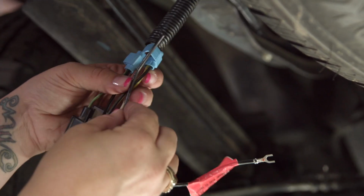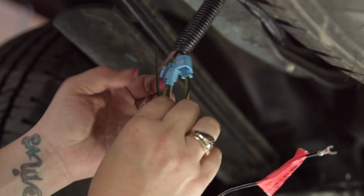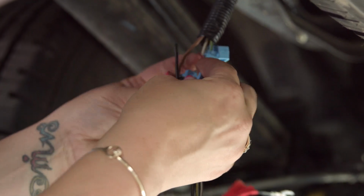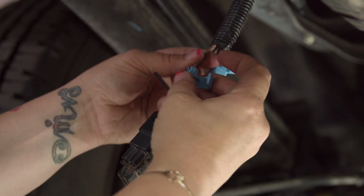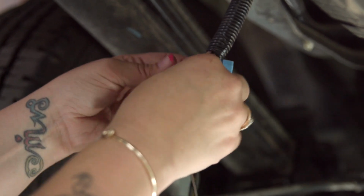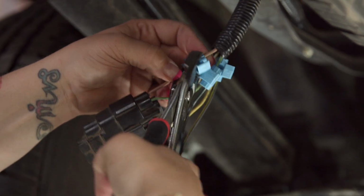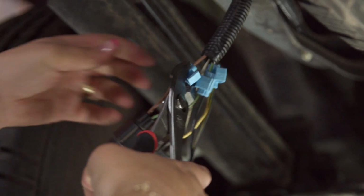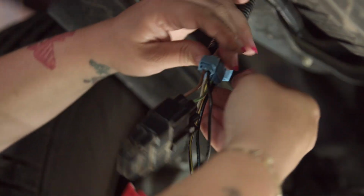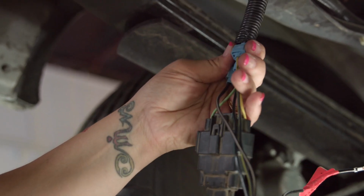And then this, you can't quite see it, but it's brown. At least I can't. I'm getting old. All right, we're gonna put the two browns together. We're gonna take the Scotch lock and I'm gonna put it a little farther down here. Get that whole wire in there. That brown in there. Make sure it's pushed in there really good so you got a really good connection with it. And squeeze. Just give a tug and it's in there. Of course that one doesn't want to, oh, there it goes. All right, so now you have the yellow, the green, and the brown connected.